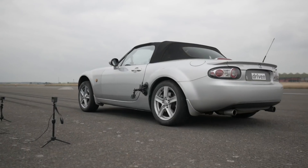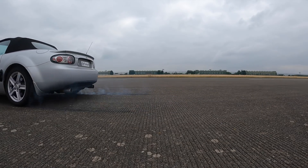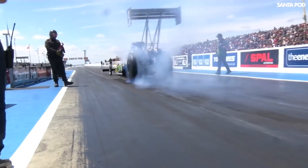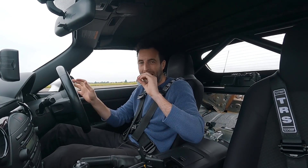One of the really clever things with the dragster tyres — when you see them crinkle up because they run such low pressure — it actually changes the gear ratio of the dragster itself. So as it crinkles up, the circumference of the tyre gets smaller, which means that the dragster can accelerate quicker, and then as the dragster gets quicker the tyre expands, therefore changing the gear ratio. It's absolutely genius.